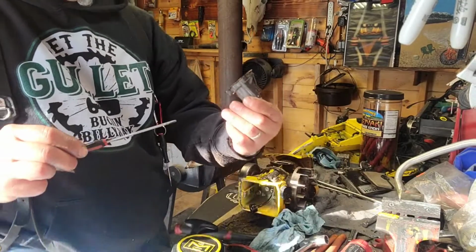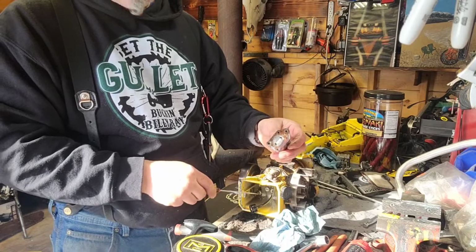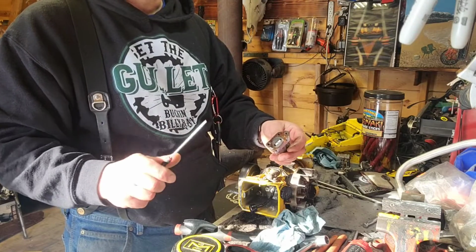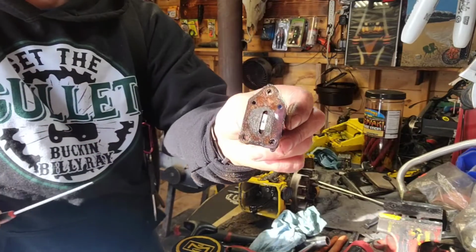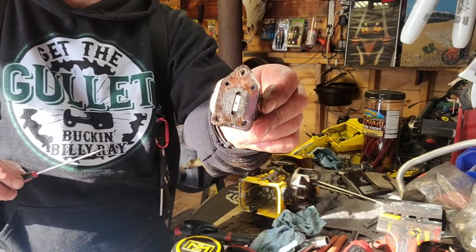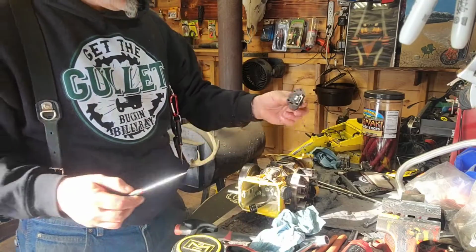But when I put it in the saw, it doesn't work. The gasket is tight. There's no air leaks, because I've had it on the saw and I put this in a pot and I've had the oil tank full and I've pumped it, and no air comes out around the gasket. So the gasket's not leaking. Oil's not going into the cylinder, because all the times that I've run it, if it had bar oil going in the cylinder, you would see that thing smoking like crazy. It smokes some now, but it would be smoking like crazy. So anyway, that's where we're at on that deal.